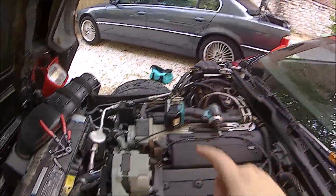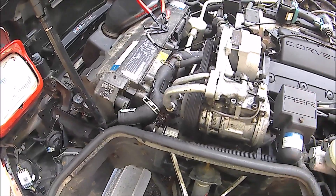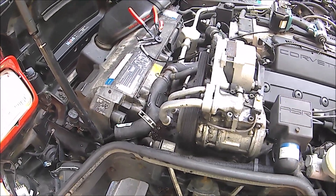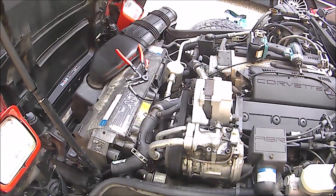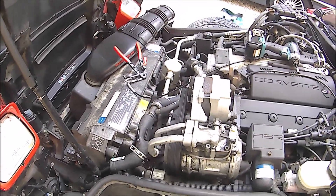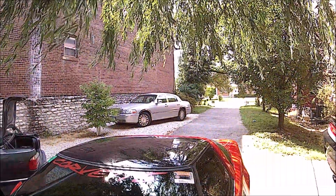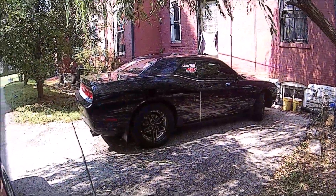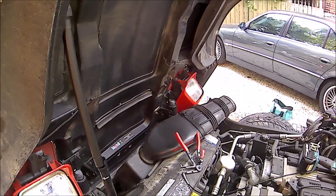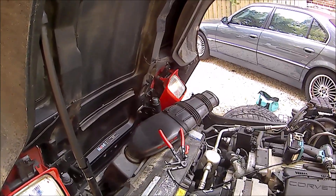Once we get those bubbles out and all that orange stuff is gone and it's just clear water, we're going to go ahead and fill it up with our 50-50 green coolant and distilled water, and then that'll be it. The vet will be back to green, and that's what we're going to keep in it. So that'll be green in this car, green in the Crown Vic, green in the BMW, green in the town car, green in the Challenger, and green in the Ram. We're going to have everything green, with the exception of the Camaro, which is the only thing running on Dex Cool. Everything else is going to be green and distilled water.